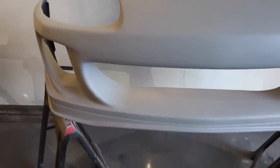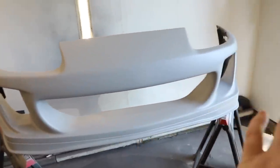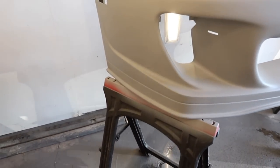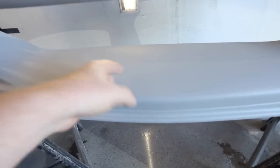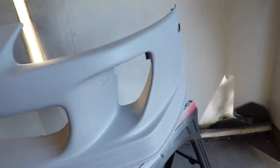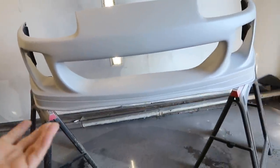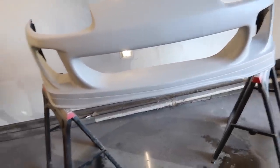Also when spraying primer, I don't think I bought the right type of primer for what I was trying to do, which was basically just do a quick color change on the base of these pieces — turn them from black to more silver so the base coat would cover evenly. And the other thing is I don't think I painted it on wet enough, so in some spots we got a little bit of dry texture. That texture is enough to put orange peel into the paint. Japanese cars don't have a lot of orange peel, so we really need to make sure we don't have that. But this is really easy — primer is meant to be sanded. We're going to grab 400 and 600 grit sandpaper and sand down all this primer so it's nice and perfectly smooth, fix any little pits, and then we're ready for base coat.